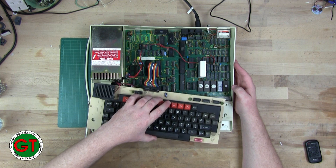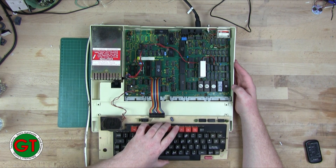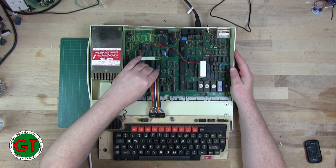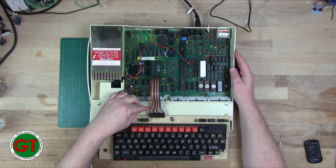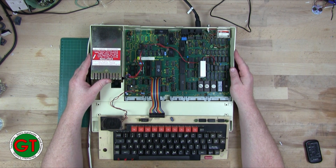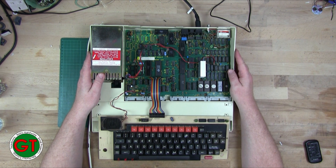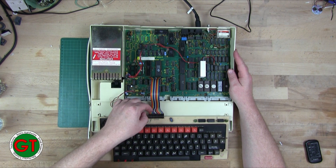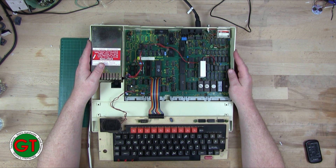The moral of this one is: if you ever have a BBC Model B and it's giving you just a black screen with a flashing cursor, the first thing to do is check the keyboard cable. Obviously if that fourth wire or the power cable isn't connected, the keyboard's not getting any power and it still won't work. On later revisions - I've seen other YouTubers with Issue 7 motherboards where the system powers up fine without the keyboard connected. You could probably do the same here if you just loop this wire back so it thinks the keyboard is connected.